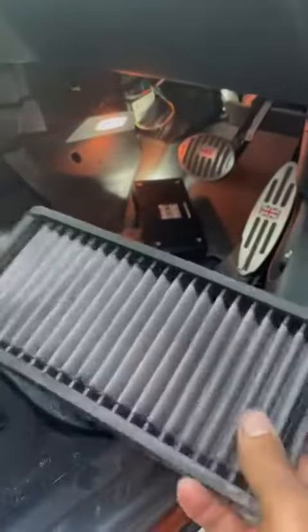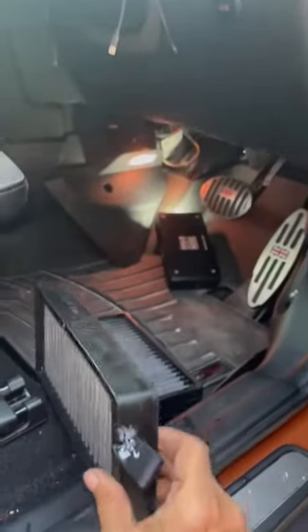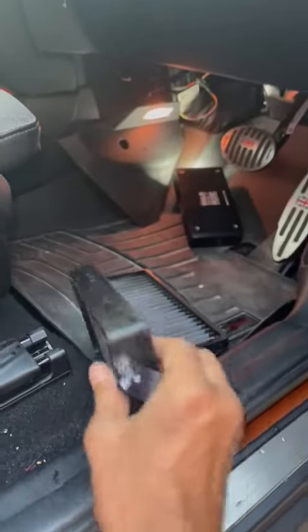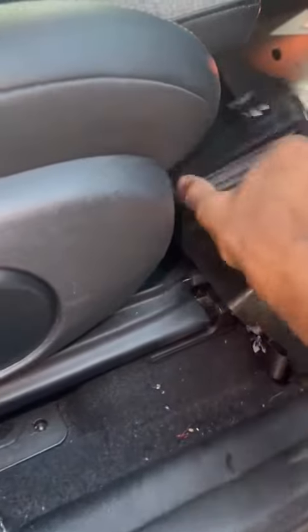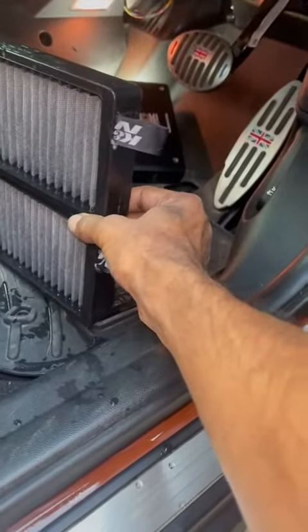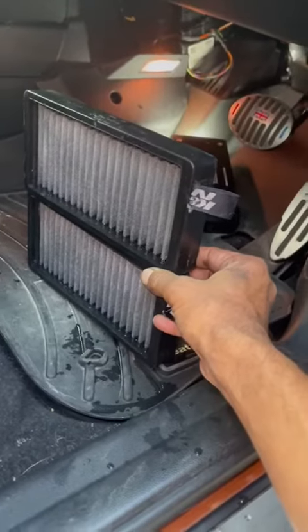The cabin air filter is actually two pieces and I use a K&N cabin air filter — it's two pieces stacked one under the other. The one that goes below slots in and dives deep, and you will have to leave the tag on the upside so that you should be able to pull it when you want to replace or clean it. They are stacked like that in that little slot door. The tag's on the outside so you should be able to pull it out when you want to.